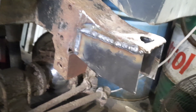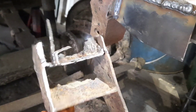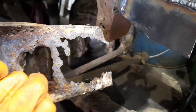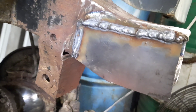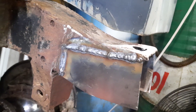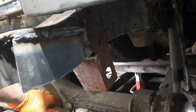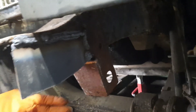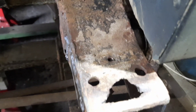I've had another bit of time on the Series 2. I've started doing the passenger side — cut the spring hanger off, which is this rotten old fella here, just as bad as the driver's side if not worse. He came off quite easily and I've fabbed up some 3mm plates, cut a template out of cardboard and cut it out of steel then welded them on. Both sides are done — I've got to cut out the bottom piece now, box that in underneath, and then I'll cut a top out for it as that's rotten.